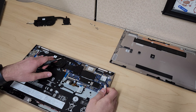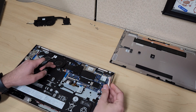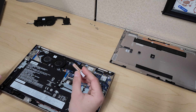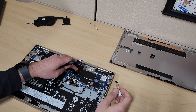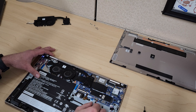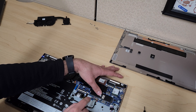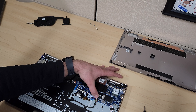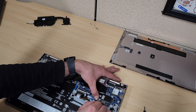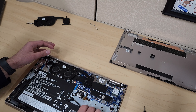Let's start by removing the screws, and again make sure you have some thermal paste — you're going to need it. When placing the replacement part we're going to place a little dab right in the center. Before you start, go ahead and unplug the battery connection. Be very gentle when doing this — you don't want to rip the connector on the motherboard side. Just wiggle it left and right a little bit and it will come out just like so, then keep that aside.